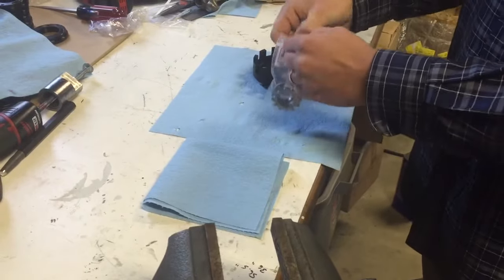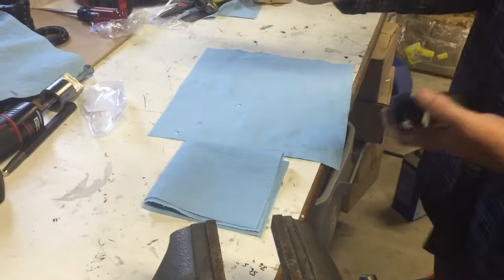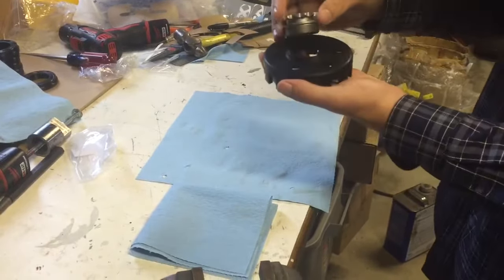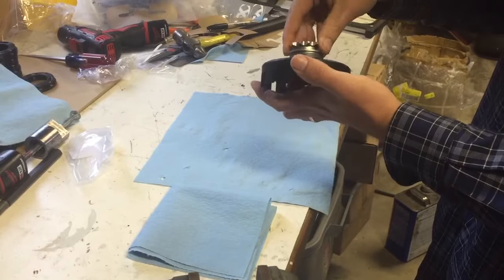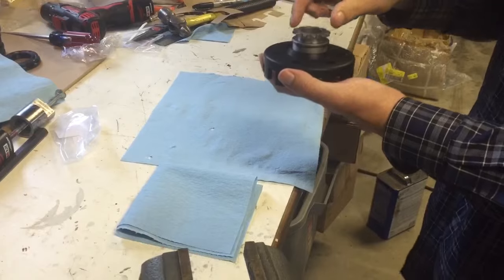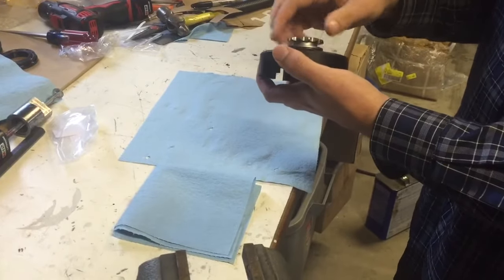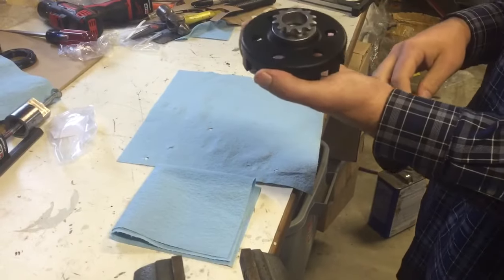The first thing you want to do is open up the bag and pull the sprocket out. You'll notice that the OD of the sprocket is threaded and that matches the threads on the bore of the clutch basket. This allows it to screw into the basket using left-handed threads, which means you have to turn the sprocket counter-clockwise for it to tighten. The reason for that is because under normal acceleration the torque from the engine is constantly acting to tighten the sprocket, preventing it from loosening.